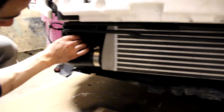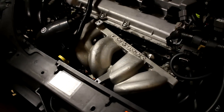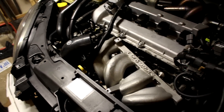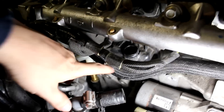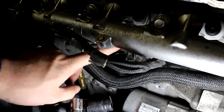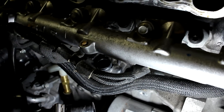With the bumper off, you can see the front-mount intercooler and the custom ducting we made — it's holding properly and not coming loose. Along with the JBR Raiders air dam, it's keeping cooling temps nice. We're now in the process of taking the intake manifold off and disconnecting the PCV line that goes to the vented catch can so we can install the new PCV plate.